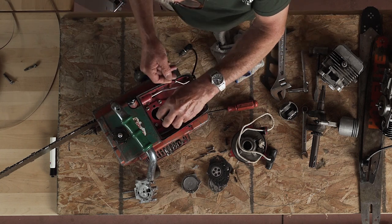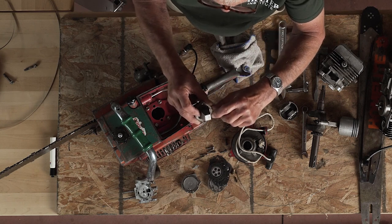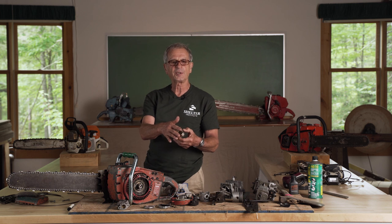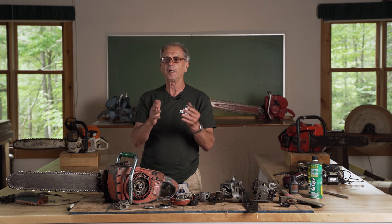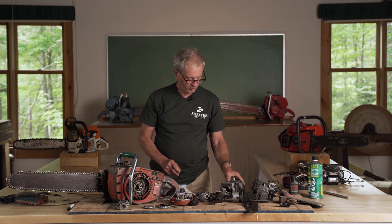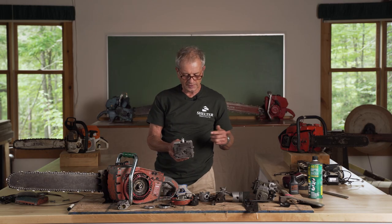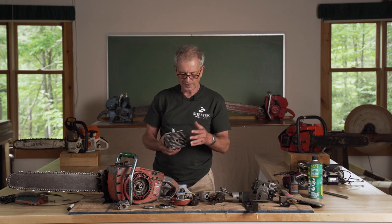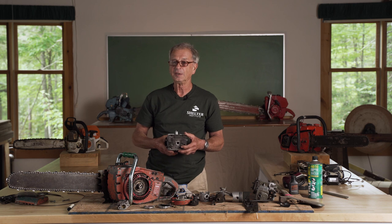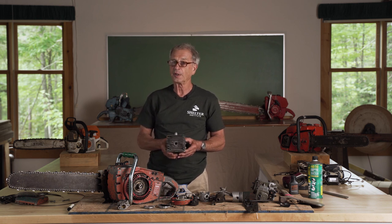The carburetor sits on top of a reed valve, and the fuel goes through that into the engine. The reed valve has little reeds — just like on a clarinet — whose purpose is to speed up the passage of fuel so it vaporizes and becomes more explosive. However, when fuel enters the carburetor and then hits a cold cylinder, it may recondense, so it's not unusual for a chainsaw to flood. The colder the chainsaw, the more likely it is to flood, so warming it up in winter before taking it into the woods is not a bad idea.